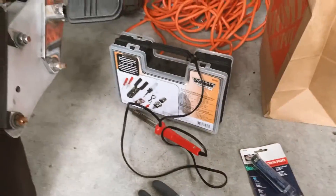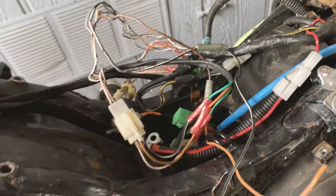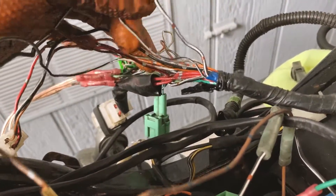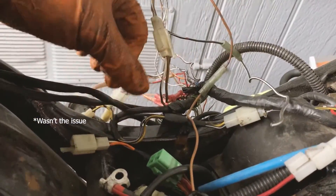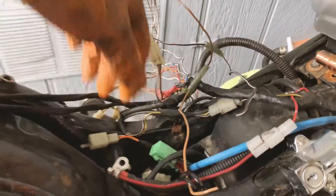It's a new day. I've got all my stuff - new wires, solder - and I have some instructions on how the wiring goes for this bike. I found that the black and white wire is the ground wire and connects pretty much everything to it. It's a pretty small wire but everything should be connected to it. Since the bike did start once, I'm pretty sure it's related to the ground wire shorting out somewhere. I'm going to change some wires and see if I can start it.